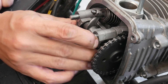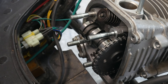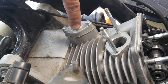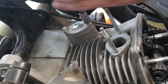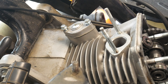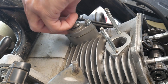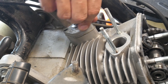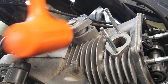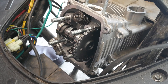With those off I should be able to loosen this up, get the cam tower off, wiggle it, and expose the cam. Before I can get out the camshaft, I need to remove this automatic cam chain tensioner. I'll loosen it up and release the tension on it, then take out the two bolts. With a little mallet — pop — there we go. The chain tensioner came right out.